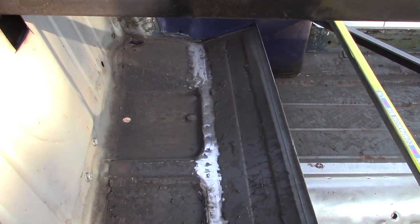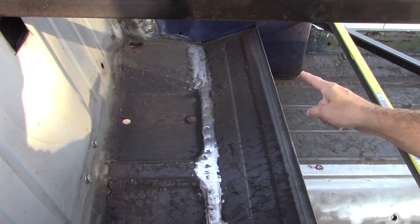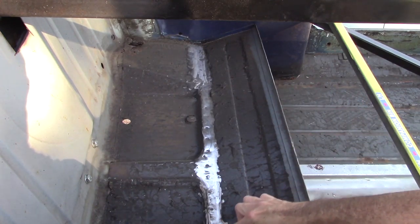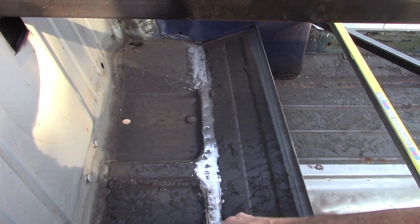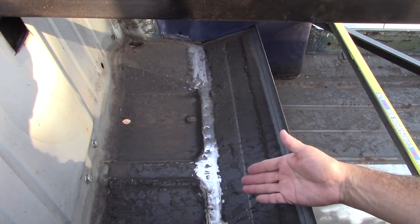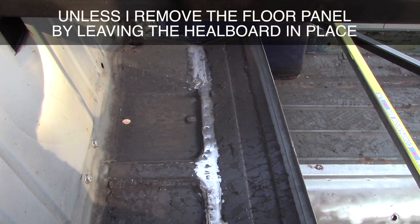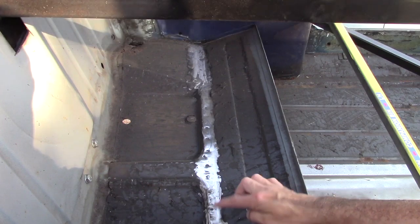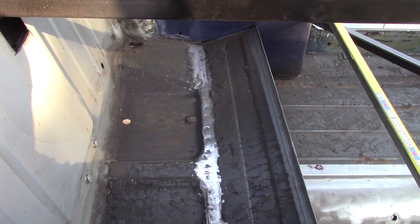I cleaned out the center of the bench from one side to the other, and this is where the heel board is welded on the top side. You can see the spot welds there. I have no choice but to remove these spot welds from the top side because I can't access it from the bottom side underneath the bench.